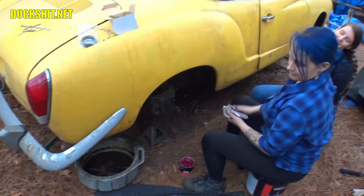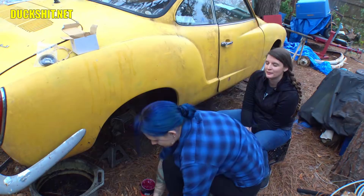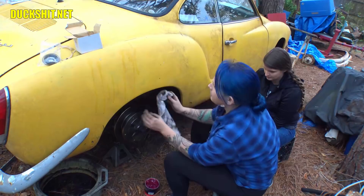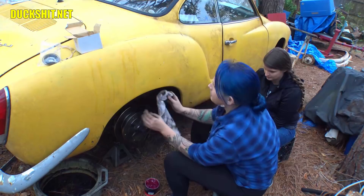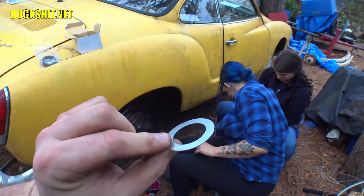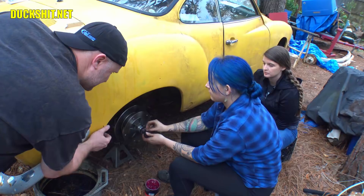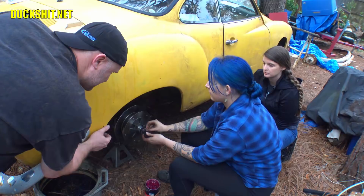You know what's next. Is it the disc? That is the disc — the disc goes on there next. She's on. Then caliper — but not yet. We have to do the nut and the pin first. I also noticed for some reason we don't have any washers on here that came off, but we're going to add one because we have them in the kit. We also need the spacer — which is technically a thick washer — and then the nut.